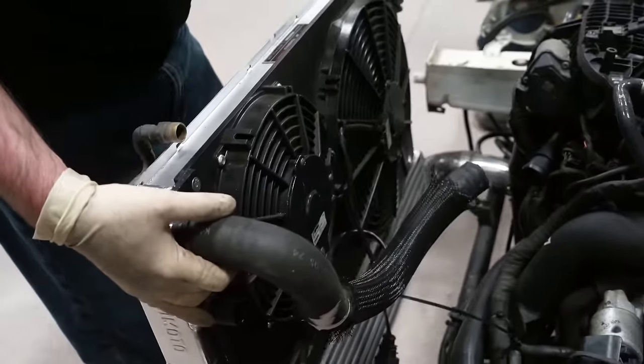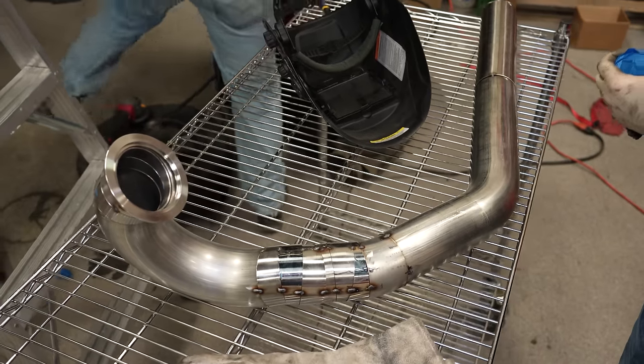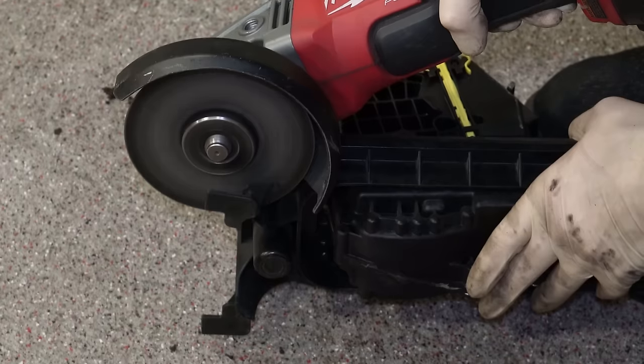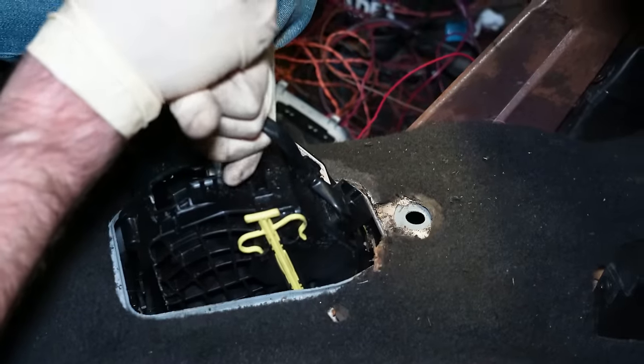Doing a project like this is a massive undertaking, and because Charles refuses to live in my closet, he can't be here for all the work. We need to make a custom downpipe for this car, but before doing that, we had to mount the DSG shifter in the car to make sure we had the clearance we need for the downpipe. To get this Mark 7 shifter box fitted, I started by trimming the shifter housing to fit inside the Mark 3 tunnel.